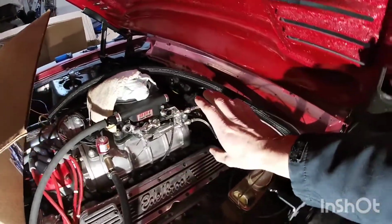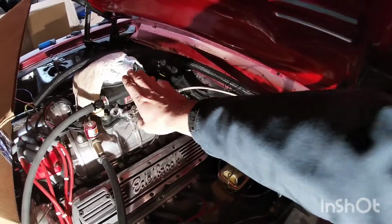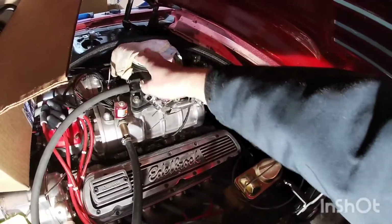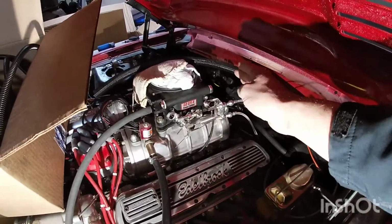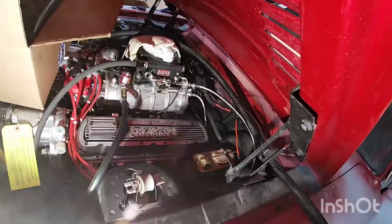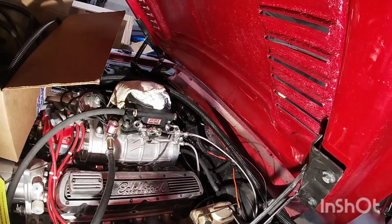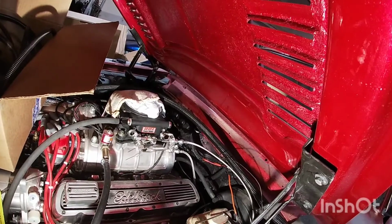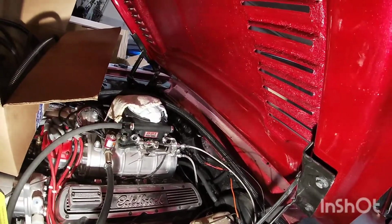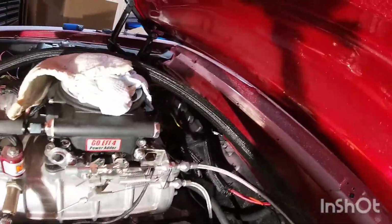I have the harness of the EFI here. I'm going to leave this piece where it is because it's right off of this. All those fuses are right next to the FI Tech unit, and so I just put them right behind there. That's, I guess, the best I was able to do. If you really wanted, you could relocate all those to a different spot, but I don't want to tear into the harness. So I left that there. The rest of the harness is inside the vehicle, connected to power and everything, but it's quite a bit of wires bunched up here.